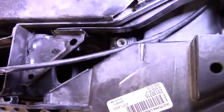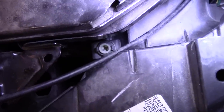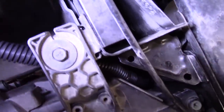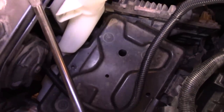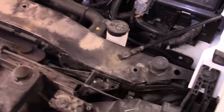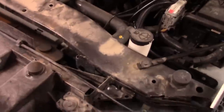My initial thought was to come in here on the top, but I don't want to cover up my headlight adjustment, so I'm going down there. I've got it fished through — fits in the notch okay. I'm going to get my light bar mounted before I zip tie it anywhere to make it permanent. I fished it down beside the headlight and on the back side of the headlight, between the headlight dust shield and the washer fluid bottle. On the Silverado I mounted the Bluetooth controller right here but that didn't work out, so I might do a Silverado update showing how I moved the Bluetooth controller and how I finished off the firewall.